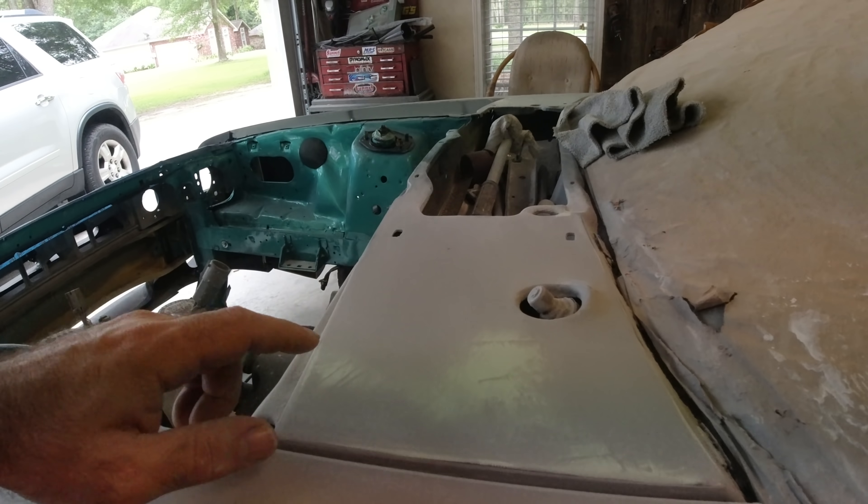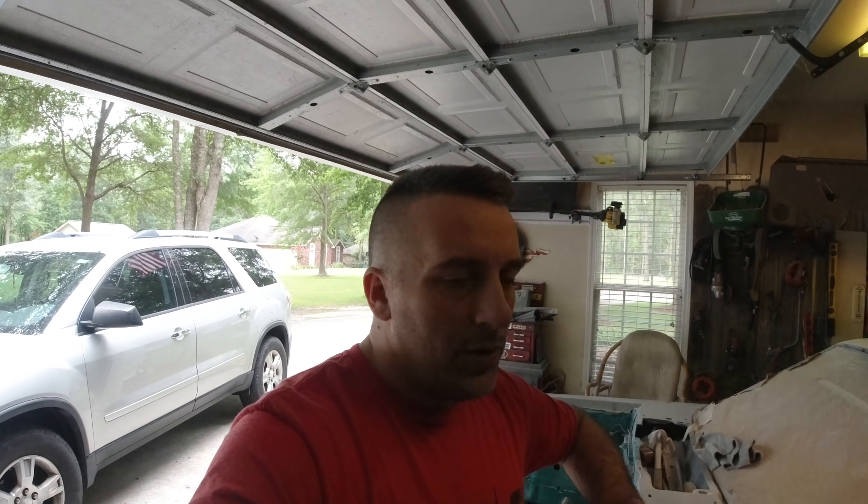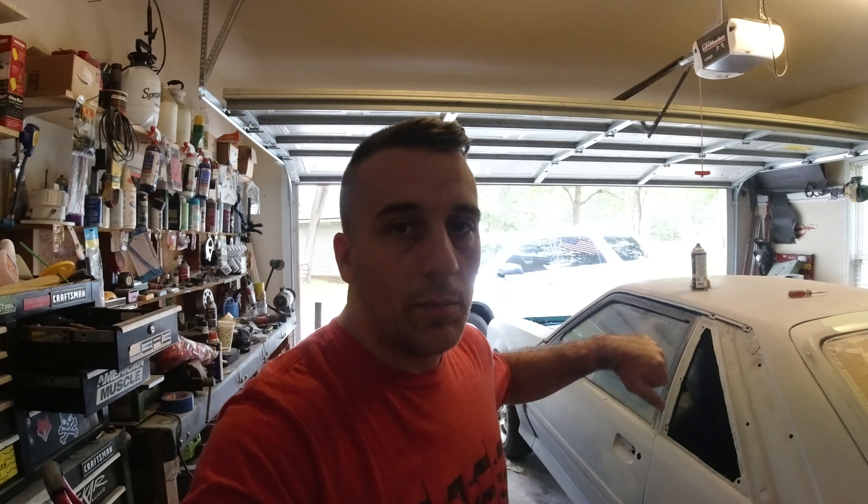It may be 10 years down the road, but at some point a lot of this body work is going to show back up just because there's filler down. That's probably one of the hardest things — managing your filler intake versus primer intake, because sanding filler is very hard. If you gouge it up too much, there's nothing to do but come back and put another light skim coat of putty on it. Even filler will shrink, especially some of this thinner stuff. I have block sanded this car out about three times already. After shooting primer, you can't just sand with your hand — you're going to put finger marks in everything. I'm just lightly scuffing up the primer with some cross-hatching and a block. The roof might need a little bit more work, might need some more primer. But guys, we are so close — I can taste it.